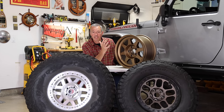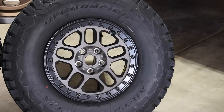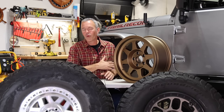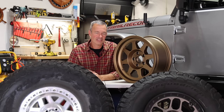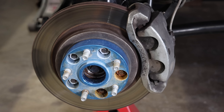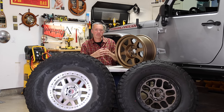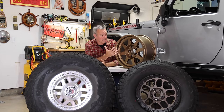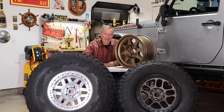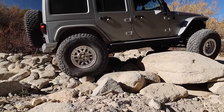Let's talk about wheel size. All three of these wheels are 17-inch, which is pretty standard on most off-road vehicles and Jeeps today. Way back when, 15-inch used to be the standard size on a Jeep — throw a 33-inch tire on there and that was a good wheel-to-sidewall combination. Today's modern vehicles have bigger brakes and bigger brake calipers, so they needed more room and had to make the wheel larger. That's why 17 inches is pretty standard now. And that doesn't mean anything is compromised — we're still throwing 35s, 39s, and 42s on there with plenty of rubber and sidewall for grip.